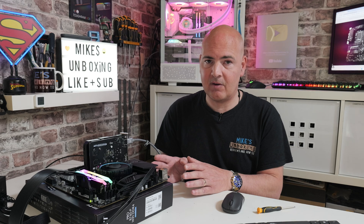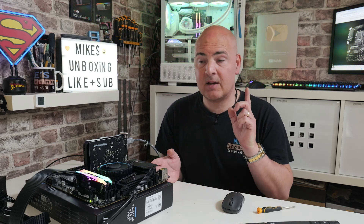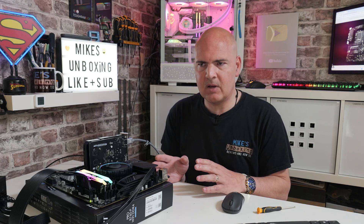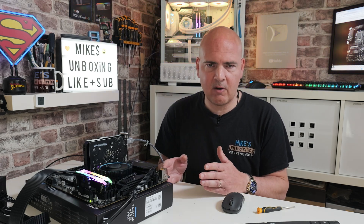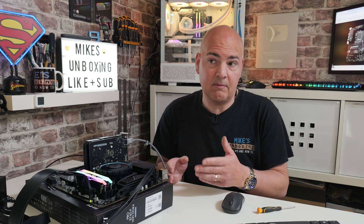So if your PC isn't getting this far, then potentially you need to roll back a bit. Now you're probably thinking: if all the CPUs are supported, why are you doing a BIOS update? Well, there's a very good reason — because of the way that Intel has mismanaged the power settings on most motherboards. Also there are vulnerabilities such as LogoFAIL and other things, as well as quality-of-life improvements such as better RAM compatibility and better stability. So it's always worth doing a BIOS update for a new build and even checking back every now and then to see if there are any new BIOSes available.